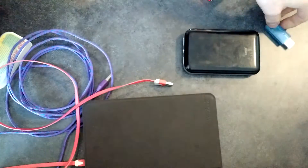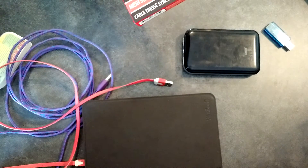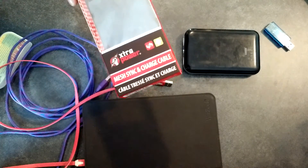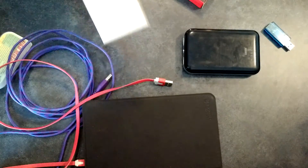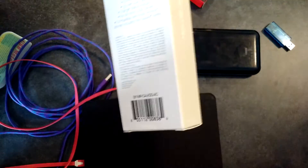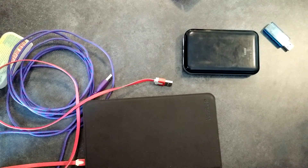You need to be very careful when buying charge cables. One of the clues is the packaging — if it's a high-end cable, it will tell you how many amps it can handle, like 'up to 2 amps' or 'up to 2.4 amps.' If it's a lower-end import, they give you fancy packaging and don't tell you the amp rating, or just say things like 'thirsty for power.' Read the labeling carefully. If your device isn't charging, try swapping cables — I had a phone I thought was broken that charged just fine with a different cable. Don't skimp; spend a little extra and your devices will charge faster and the cable will last longer.